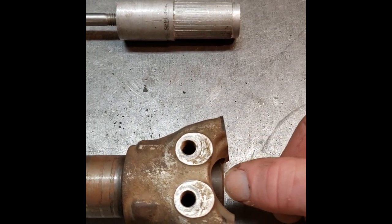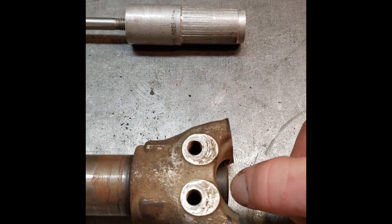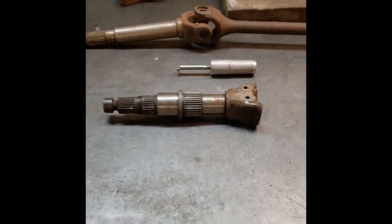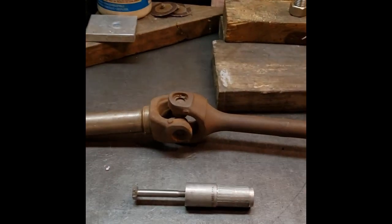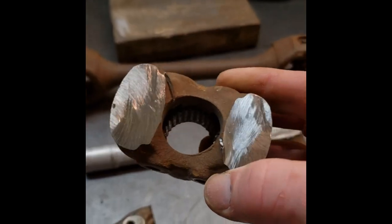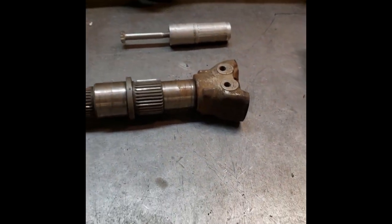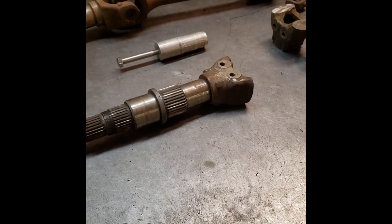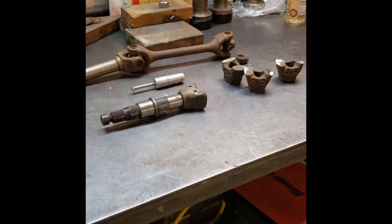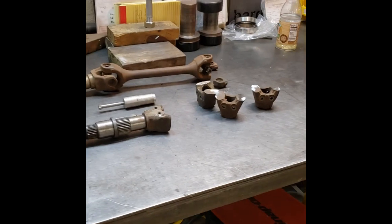There's a nub on the axle right here that comes out — it will be machined back so that nub sticks out, and a pocket will be put in the back of the CV cup. That adds stability because these blind adapters on the factory axle were never designed to prevent wobble or keep a CV straight. We do everything we can to add stability and strength, and after everything is assembled it all gets reheat treated.